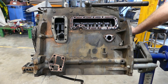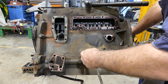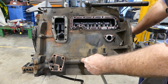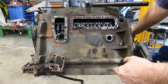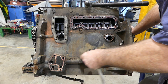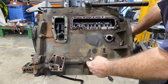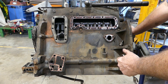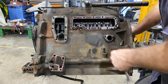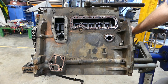These holes — you'll find that where these are, if you look inside there'll be a drilling that goes through to the main bearings. That's how they set them up in the factory. When they set them up they had to have a way of drilling the cross-journal, so they put a hole straight through, then just blocked it up and used it for oil gauges and anything else. That's your main oil supply. Then there's one that comes up here to the cam, and then the cam sends oil up to your cylinder head — so we'll trace all that once we get the block apart.